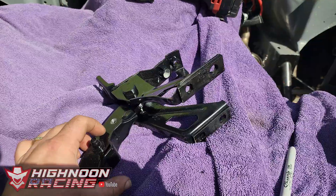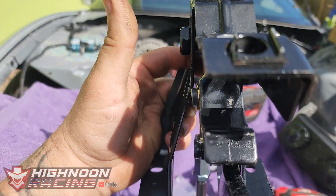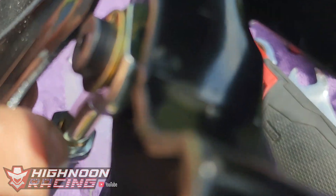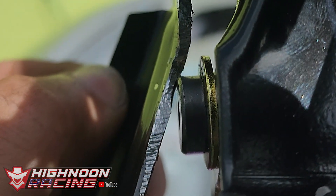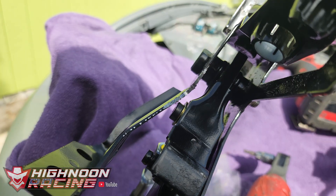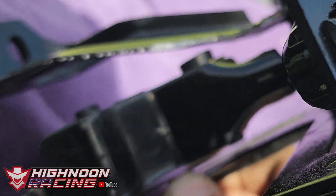We'll make sure it can fit through — there's clearance on both sides, might have to do some trimming or bending, and we'll show you that if we do. The pedal would totally hit right there, so we can't have that. We need way more clearance. What we can do is just notch it out right there — grind a little or bend a little. Use your imagination.